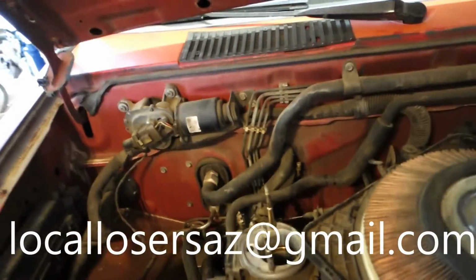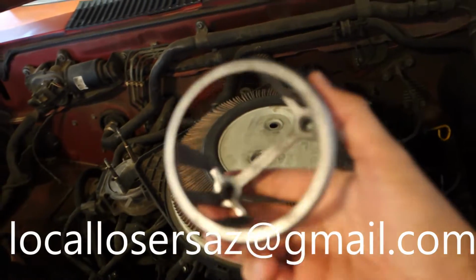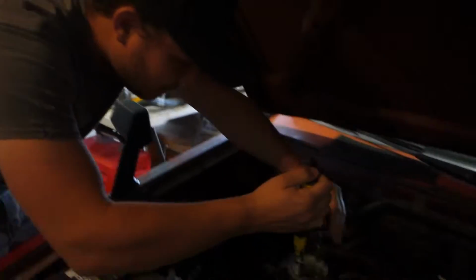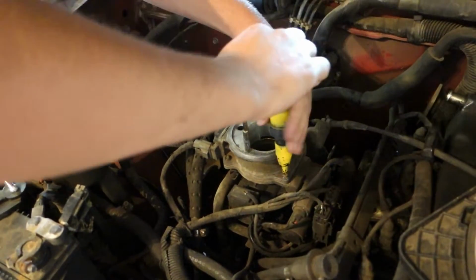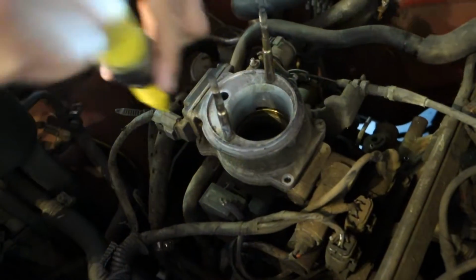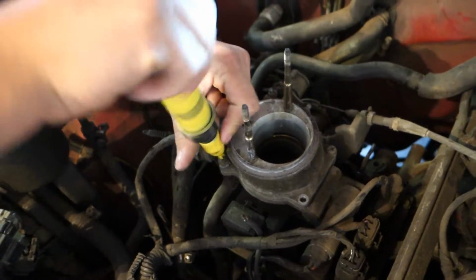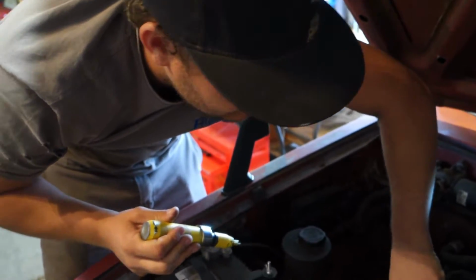Let's take this off. Let's put this thing on. Take this off and put that on. And see what we can do. We already took the air cleaner off. So, let me get that out of the way. I use my impact driver because the bit fits this really well. Yeah, I noticed the Phillips hole was kind of big. So it's four Phillips screws. Meaning it's like a 2.5 minute install. Yep, it's super easy.